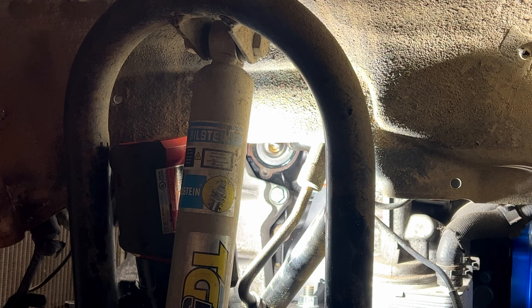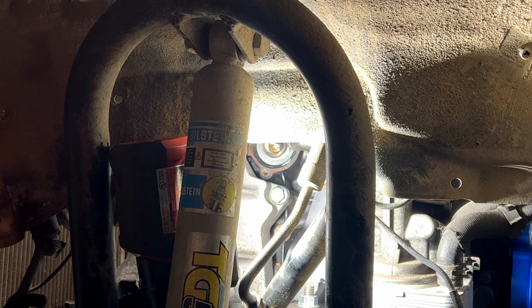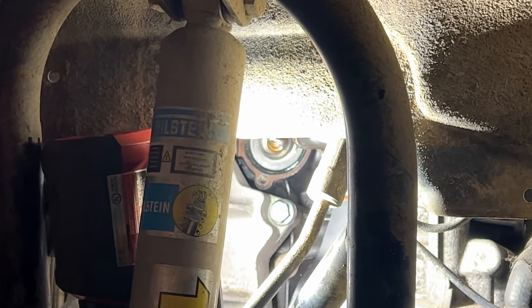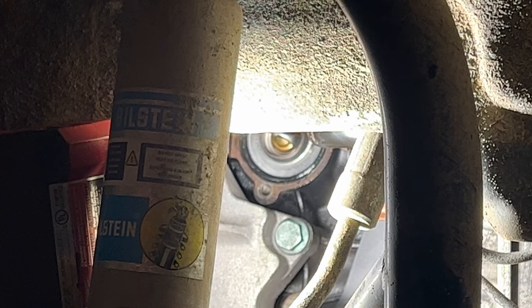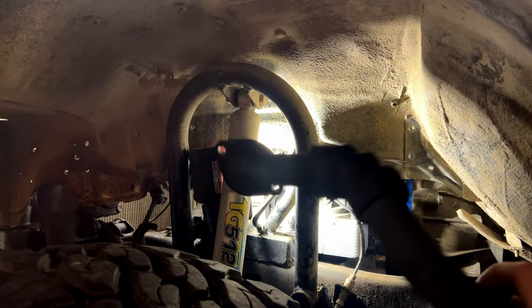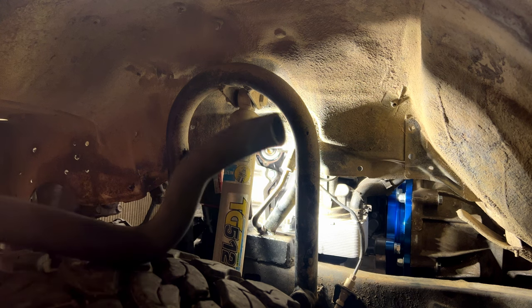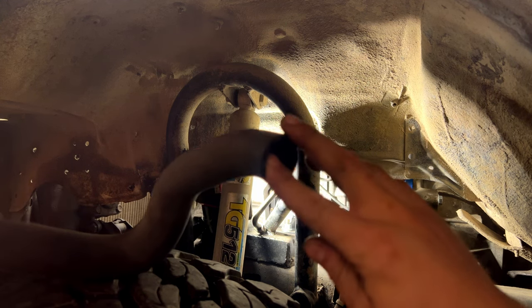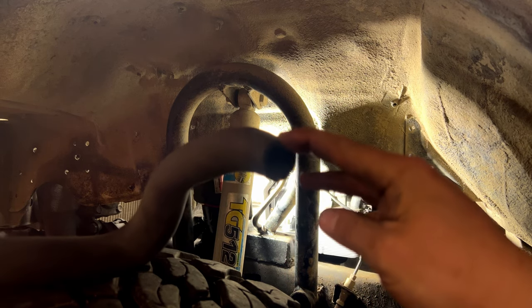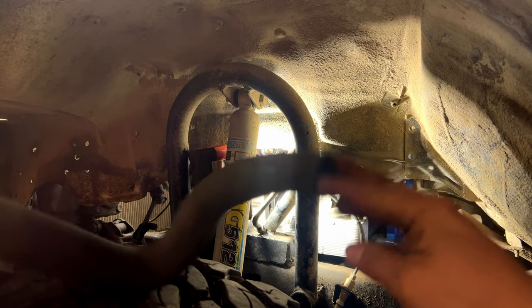Just remembered — before we go further I want to get the lower rad hose in, and it goes right behind that giant alternator bracket. I'm going in through the driver's side fender well, and I've staged the thermostat and O-ring up in there. I have to snake this hose in — it's a preformed hose with the thermostat housing attached. This is a Volkswagen thing. It's one inch ID on this end, so I'm going to have to adapt that to a small piece of pipe and then to a more common one-and-a-quarter or one-and-three-eighths, but we'll figure that out once we get the intercooler in and do all the other piping.